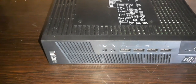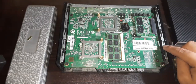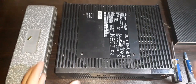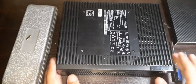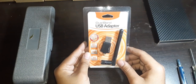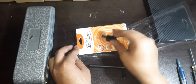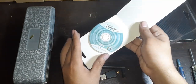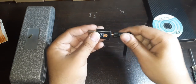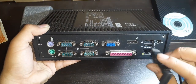We are almost done with the upgrades. Since the upgrade process is complete, it's time to install the top panel back in place — simply align the top panel clips to the frame, slide the panel backwards, and screw it in place. The last thing to do is install the USB WiFi dongle. Simply screw the antenna to the USB receiver and plug the USB into your desired location — either the front or back IO ports. I prefer to put it at the back.